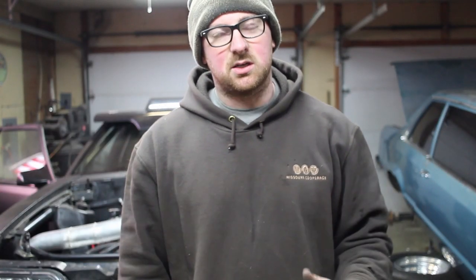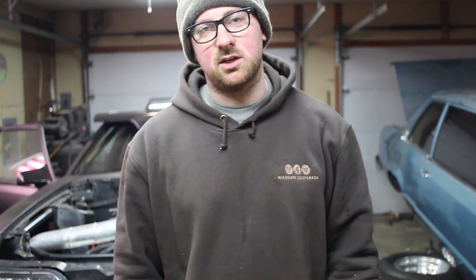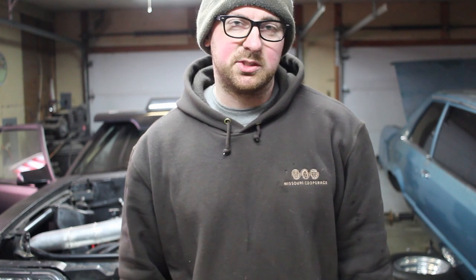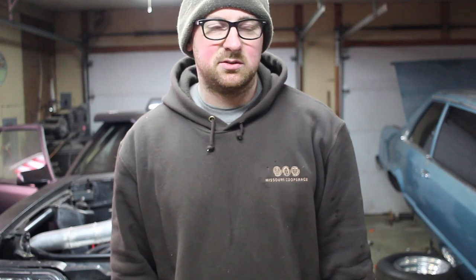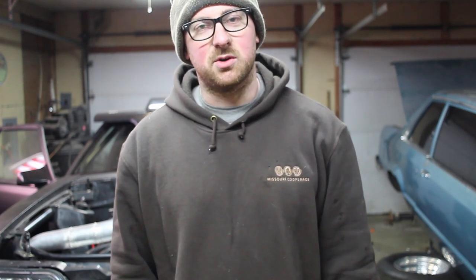I verified my timing — I locked it in at 20 degrees in the Holley software and it was dead on. I locked it in at 25 degrees and it was dead on. So I wasn't soft like everyone was thinking, which is pretty cool. I'm glad I wasn't leaving a bunch on the table. Joey checked my plugs — he's good at reading plugs — and he said that's about where he runs them on the heat mark, so I'm doing pretty good on timing. Now I just need to figure out why I was smoking so much, and we'll dig into that more. But we now know my timing is verified and dead on — we're good to go.